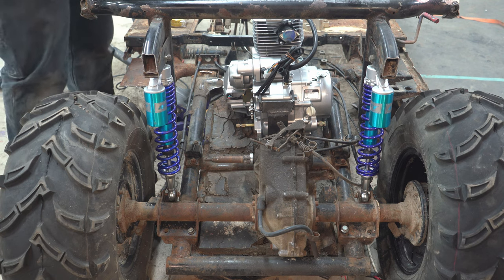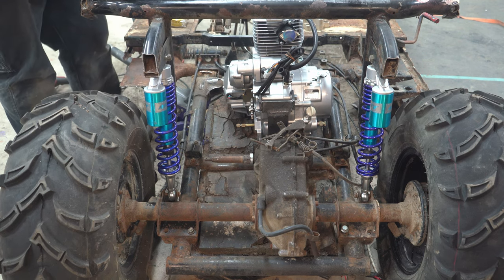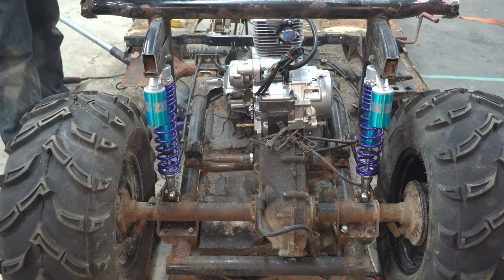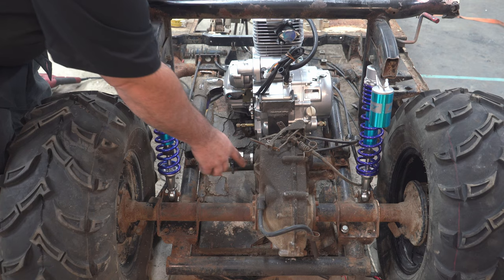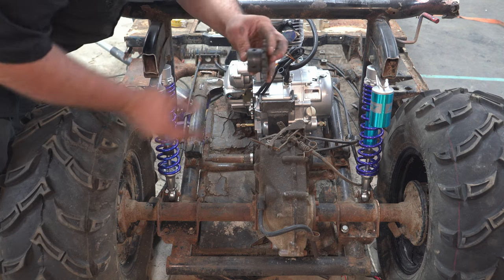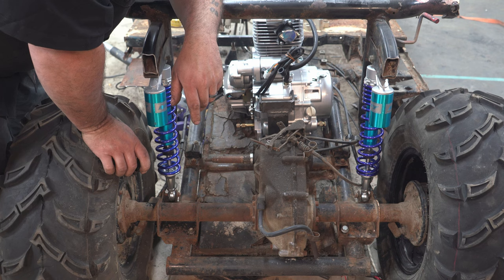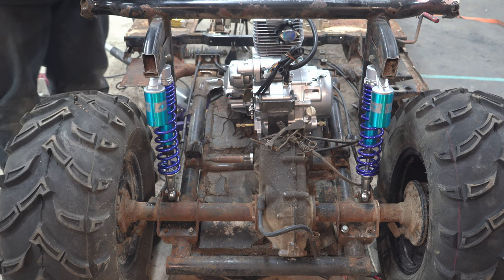That way we can unbolt those and bring the whole motor out. I can do the same up here because this motor mount is actually welded to the frame — but it's got a through bolt. So what we'll do is weld on some steel so we can have four or six bolts. I have to work on this rear end and shave it down. We got this sprocket — it goes up over here but not over here — and I just have to shave it a little bit. We bought cotter keys so I could cut cotter key slots, and that's where it's going to go. Then we're going to get that chain on and get this motor into place, and weld in our new mounts that we can unbolt. So I guess I got to figure out how I'm going to shave this down, and then we can machine this shaft down to fit this collar. We're going to roll this and run the grinder — I've done something similar to a crankshaft before on a go-kart and it worked great.